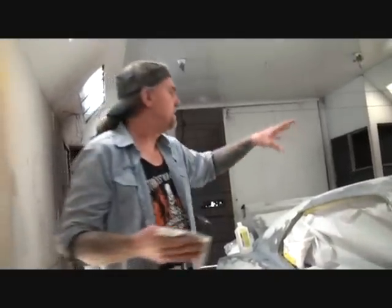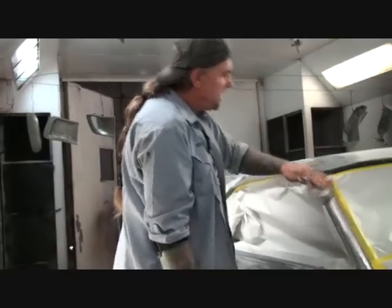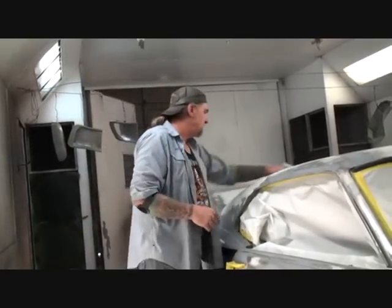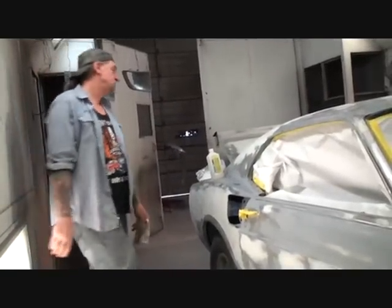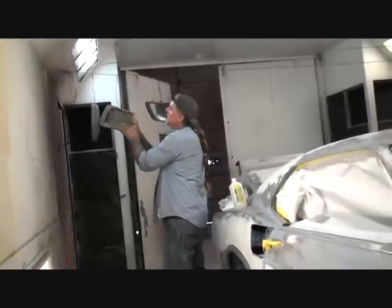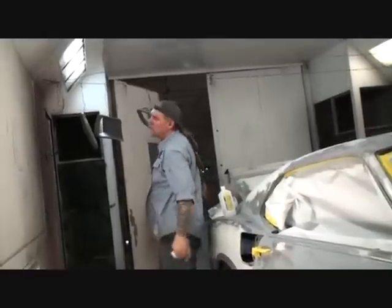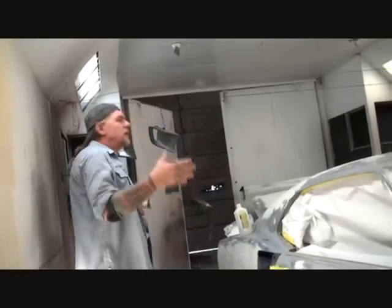You do not want to use wax and grease remover when doing this. Wax and grease remover takes a long time to dry, and it will actually penetrate into the Bondo. We don't want that. All we want is a nice, clean wipe — get the scum off and go down the road. This side of the car is ready to prime. You know when you use wax and grease remover, you've always told me don't over-wipe it, just one time quickly. That's right. Because the more you wipe it, the wax and grease remover saturates all the wax and grease — it penetrates into your primer or your Bondo. That's why you don't use wax and grease remover when cleaning your car for primer.